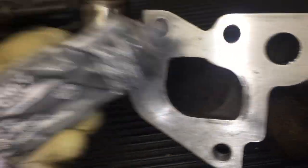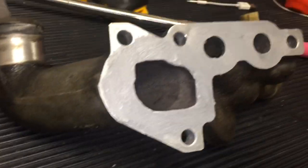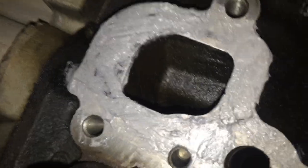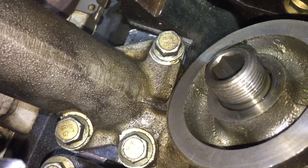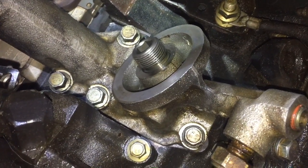This next part is optional: we're going to put a little bit of Permatex gasket maker on it — super super thin, just spreading it with a finger — to help fill in some of those pits. We did the same on the block side: a very thin coating, spread so thin it's almost not even there. Next, put the gasket on the adapter and run two bolts through it so it stays in place, then lift it up and tighten it down. Replace all four bolts evenly — probably top ones then bottom ones.